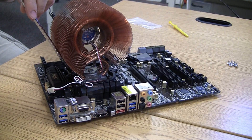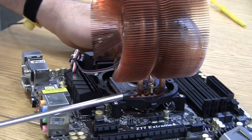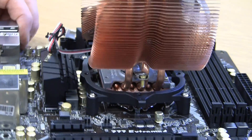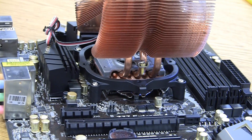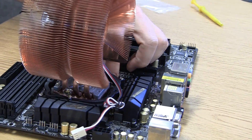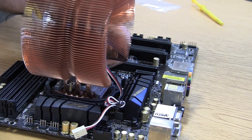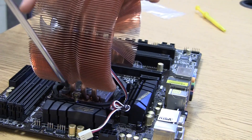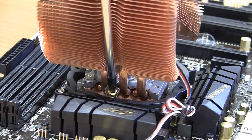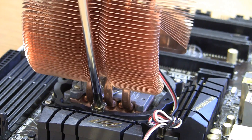Let's talk about understanding thermal compound. First of all, too much compound can actually detract from its effectiveness. The entire purpose of thermal paste is to fill air pockets in the metals of the CPU and its cooler, and adding so much thermal paste that it significantly increases the distance between the CPU and cooler will be detrimental. If you put down enough that it packs down and comes out of the sides of the cooler, that is too much. Keep it small and simple — about half the size of a penny, a pea, something like that. It is actually better to have too little thermal paste than too much, as it can decrease the ability to properly cool.